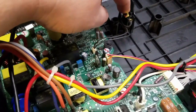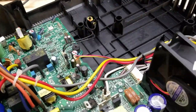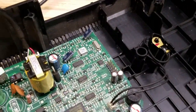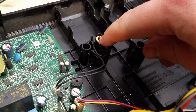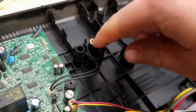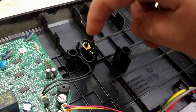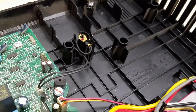The one thing I did see is this little component here. When everything's together, it's right next to the battery compartment. There's actually a little window in the battery compartment to look at it — right here, my finger fits right over it. I haven't been able to confirm this, but it wouldn't surprise me if this was some sort of temperature sensor. If those batteries got really hot during charging, that temperature sensor could trip and possibly gum up the works, or maybe the sensor is not working correctly after it got tripped.